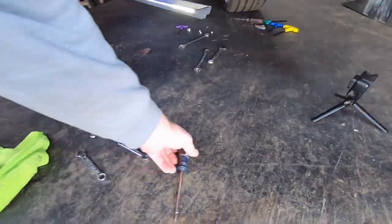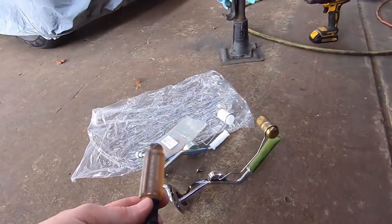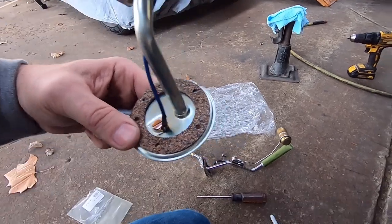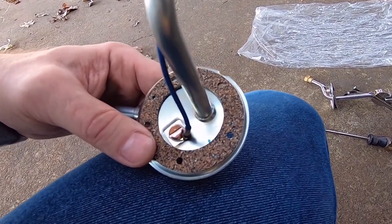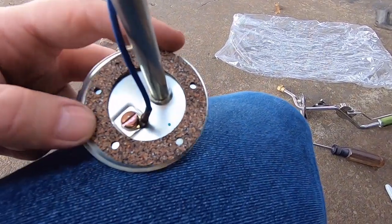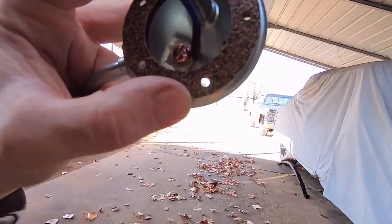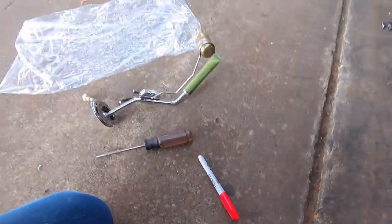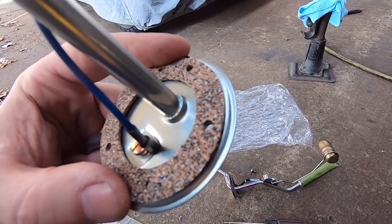If you just want to buy one clutch head screwdriver, the size you need is a 3/16-inch clutch drive - that's the one for these screws. Now here's something important about the gasket: you have to spin it around on the sending unit until you find the orientation where all the holes line up. One position will not line up - you can see that. When you rotate it to the correct position, they all line up. Don't just stick it on there and start running a screw through it. I'm going to mark the corner edge with a red Sharpie so I can clock it correctly when I'm under the car.